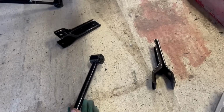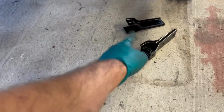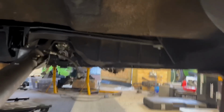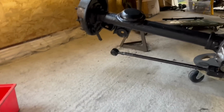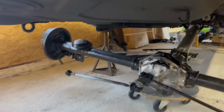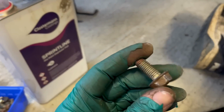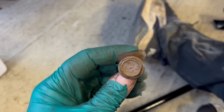You find me pausing for a moment. Got one of those frustrating chicken and egg type problems. This is a trailing arm assembly. So you have the 2 forks one either side, and they bolt to the chassis there and over there. They would be the next things to fit, or certainly the forks, because I want to fit the fuel tank, and the fuel tank kind of covers that area when it's in, so I want to mount the fork now. Problem being, the bolts I should be using are these, which are, again, trilobular triangle profile locking bolts, but they're rather crappy and I don't particularly want to reuse them.